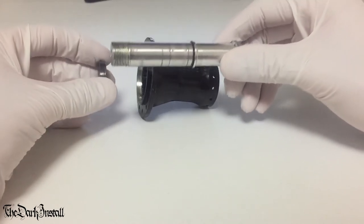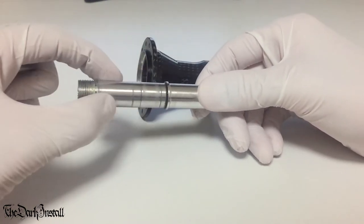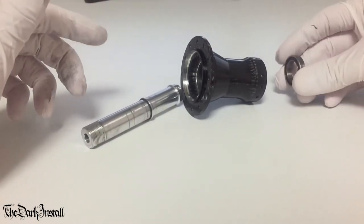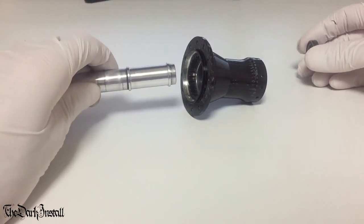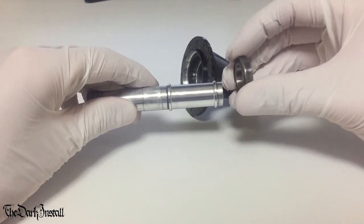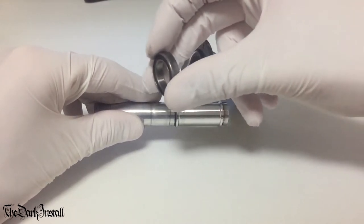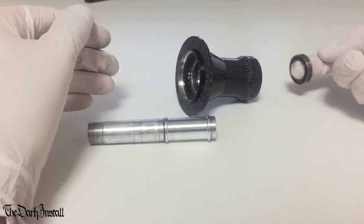The best way to do this is to press in the side which has the long part of the axle sticking out of it. Now in this case, this will be the freebody here. So we're going to press in the bearing this side first, then slide the axle through from this side, and then press in the second bearing here. The reason we do this is that pressing in the second bearing requires the axle to be in position, and getting the bearing on this end where there's nothing sticking out the other side is a lot easier in terms of pressing it in than sliding the bearing on from this side and pressing it all the way down onto here. I would go so far as to say it's impossible to do it this way. So we press the bearing in this side first, slide the axle through, and then finish off by pressing in the bearing on this side.